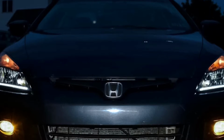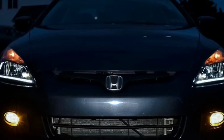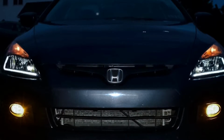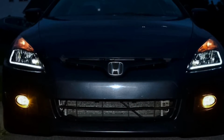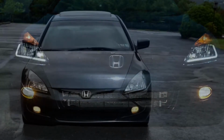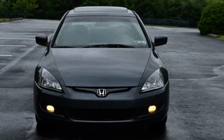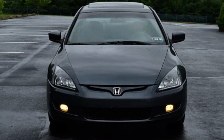Also, the way we wired the lights up, we wanted to make sure that the fog lights could not be turned on with the car's ignition off. So yeah, that was one of the things. Didn't want to risk, you know, running his battery down by accidentally leaving the fogs on. And secondly, we did leave the switch the way it was. I didn't try to wire up the aftermarket one. We still have it, but it's just not something that either one of us has been worried about.